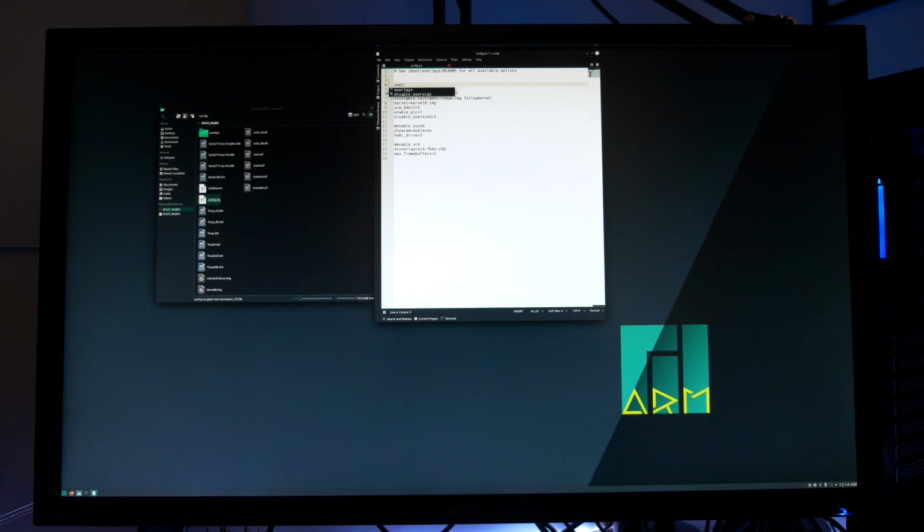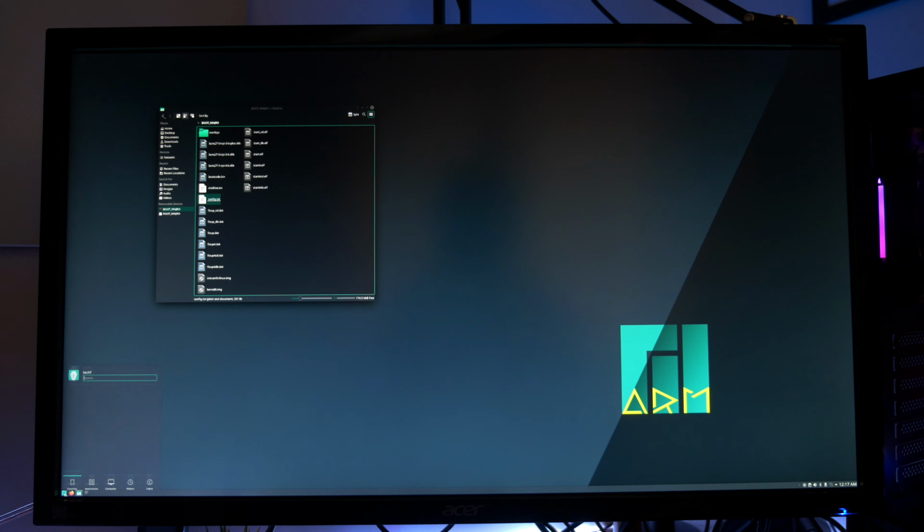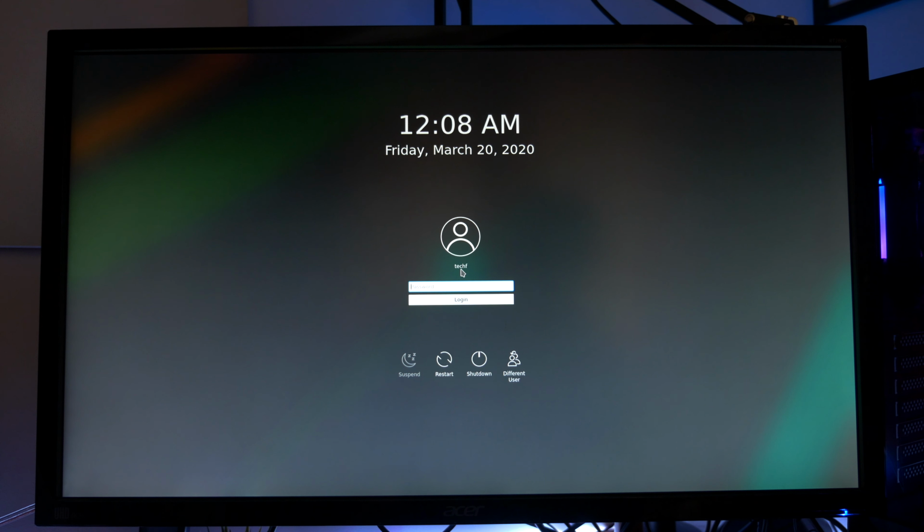Okay, the first thing I'm going to do is edit my config.txt file. So I'm going to overclock the Raspberry Pi to 2 GHz and then just exit and save the file. All details are in the description below, guys. Then all we have to do is do a quick reboot and we should log back into our overclocked system.